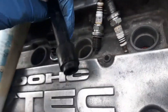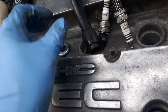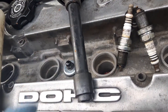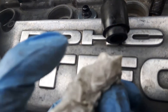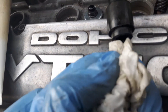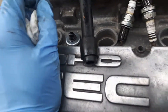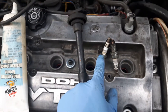This is the spark plug wire. Inside here has to be cleaned because this still has the track. So right here, just use a tissue like this and put some grease or other lubricant — engine oil maybe even — and turn it. A piece of cloth is better actually; this tissue breaks down. Rub it a little bit and take the carbon out. Then install this.